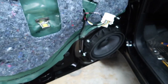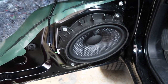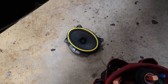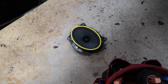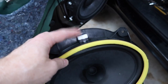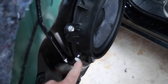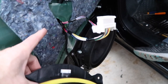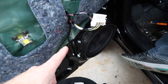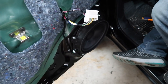In case you've never seen the Focal Perfect Fit in previous videos — the Focal is already in. It plugs into the factory. Down here on the floor is the factory speaker. The main difference that usually gives us issues: the plug is located here on the factory unit, but on the Focal the plug is located on the end. Sometimes you have to cut some tape and stretch the wire, or in some cases cut and extend the wire by soldering to make it longer so it'll plug right in.